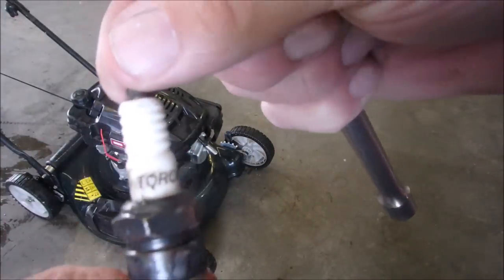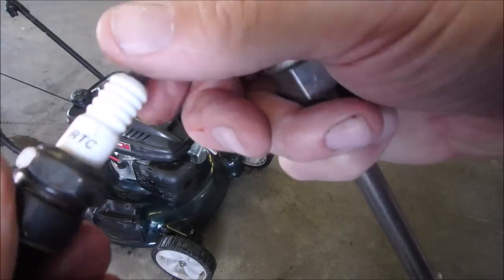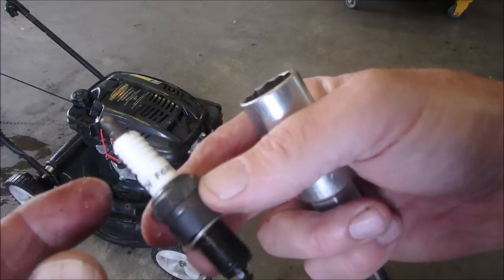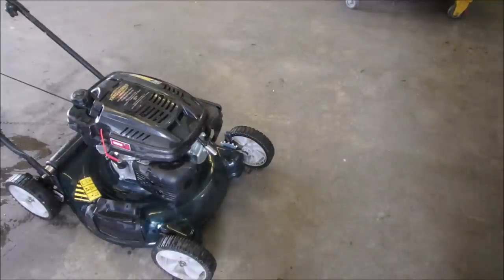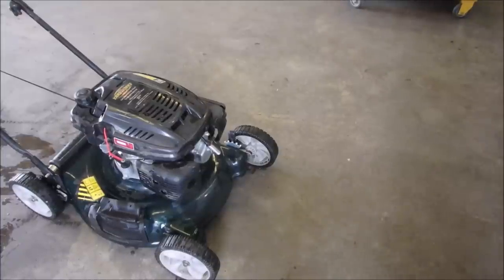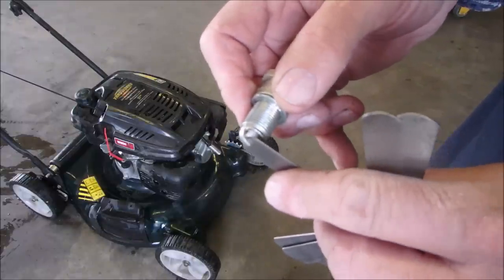Now what is it? It's a torch! There's guys that have had luck with them and guys that haven't. This is equivalent to the NGK BPR6ES — you see that F6 on there? Did we put a new plug into that bad boy? It's not costing me anything, let's do it. So the gap for the Hondas on these is 28 thousandths, and the old RJ19LM is 30 thousandths. I actually labeled my feeler gauges because they were getting hard to read. Let's see if this is 28 thousandths.